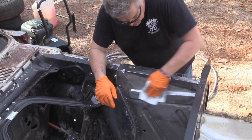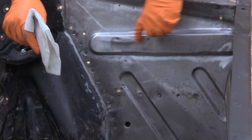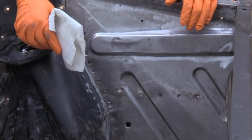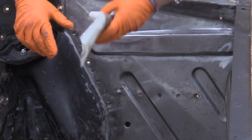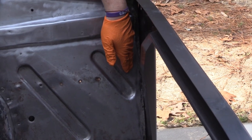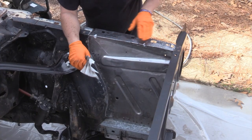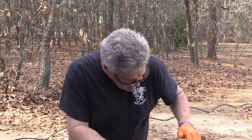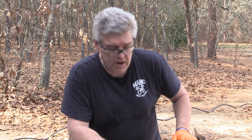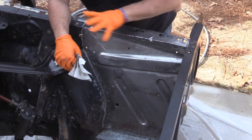Going back over with a little bit of pre-cleaner; I'll probably go back in and hit it one more time. Most of these dimples you see in here are factory dimples — that's probably for the washer motor, but this was such a base Ranchero they didn't even get a washer motor. These areas over here I'm going to hit with 400 or 220-grit, something without a lot of tooth, because I don't want to grain this metal up any more than necessary. I'll put a little primer on here — possibly a red iron oxide primer — then semi-gloss black the entire engine bay.